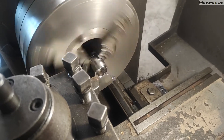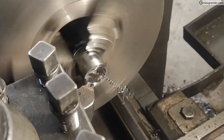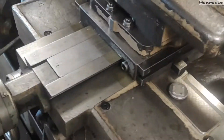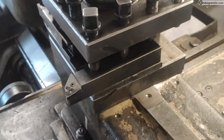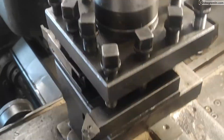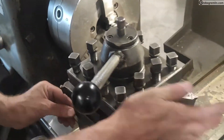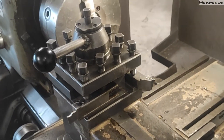In this case, I wanted to remove that to have thicker material in order to make the tool last longer. We used this machine to prevent overheating and thus reducing the metal hardness — I'm not sure the English term is 'tempering' — I didn't want to undo that procedure. So that was the first thing we had to do.